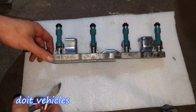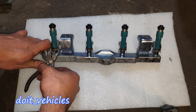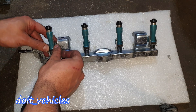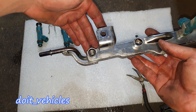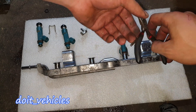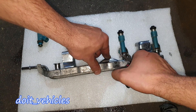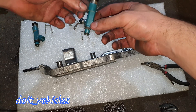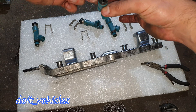Fortunately it's very easy to detect — just inspect the gaskets and they should be in good condition. Here we've got the fuel rail. The side clips need to be removed. Make sure you've emptied the fuel rail first. If you work in a closed space, make sure you have proper ventilation — you don't want to inhale too much gasoline. Inspect the gaskets as well; these are very important, probably even more important than checking how much fuel comes out of the injectors.